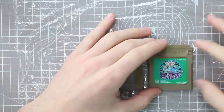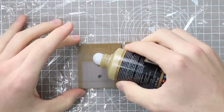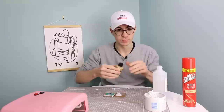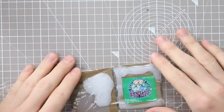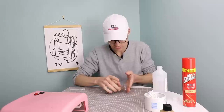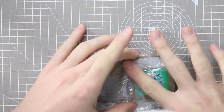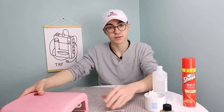So you just place those two pieces in there like that, take your cream peroxide, and apply it generously onto the front and the back. I'm going to try and go around the label although I'm pretty certain this label is more or less toast. Don't get any of this on your hands because it will just stain your skin for a little bit — it's not permanent but it's not ideal. Then you place it and tighten up the cling film so it's nice and sealed in there, leave a little bit of room down the middle so it can get there as well, and squeeze the cream peroxide around the edges.